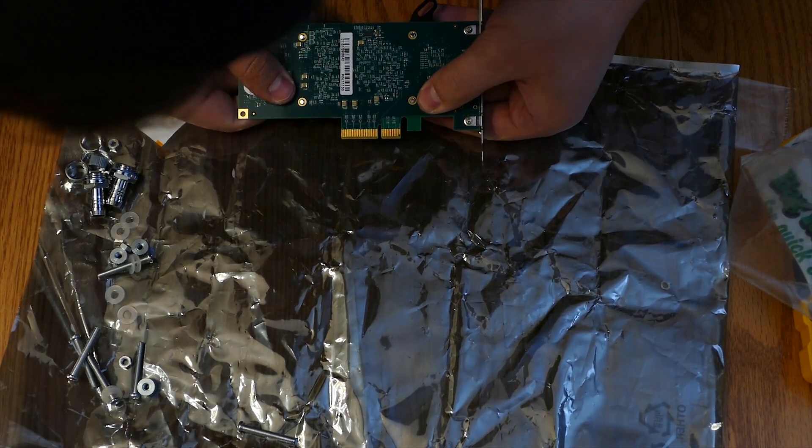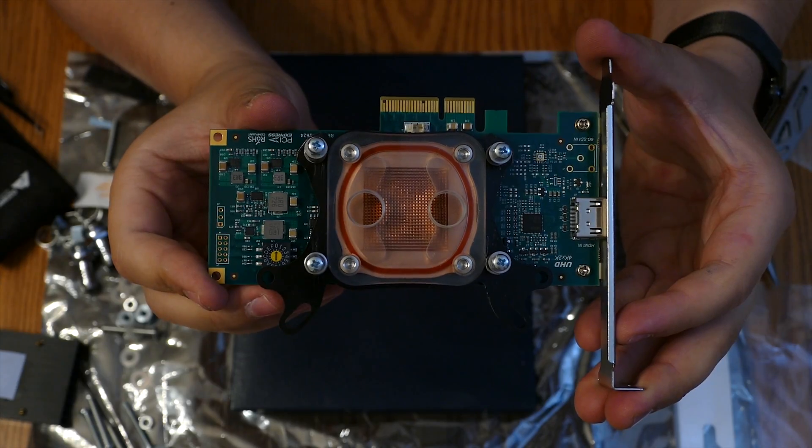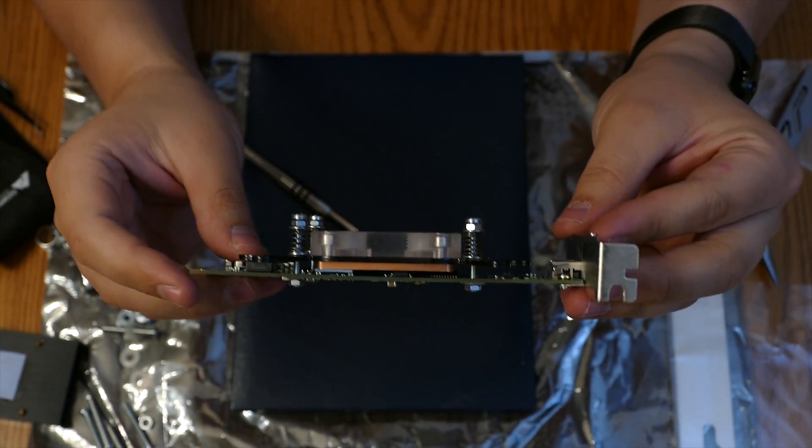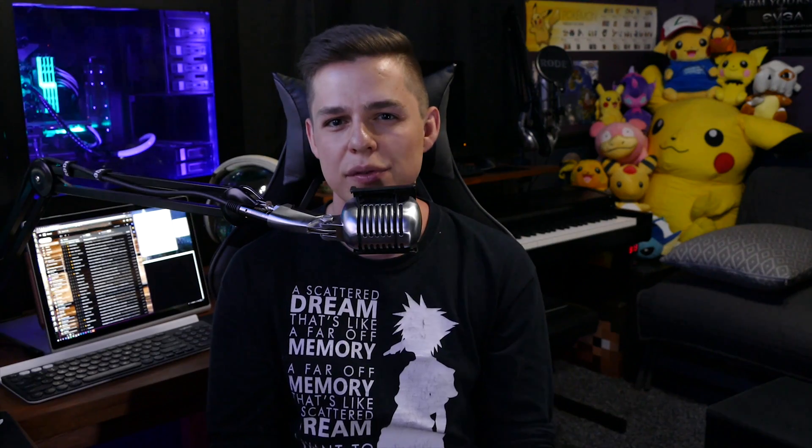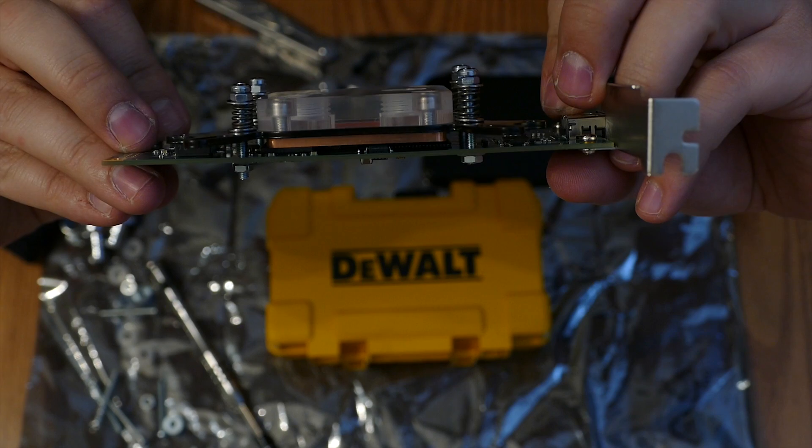I went ahead and got everything mounted. Flipping the card over without the screws falling out is actually much more difficult than it sounds, but eventually I got it to work. When looking very closely under good lighting, I could see that the water block wasn't making perfect contact across the main processing chip. This was kind of strange, as the old cooler was also just a flat piece of metal like the water block, and the graphite thermal pad was basically the same thickness as the old pad they were using on the same chip. Additionally, I reused the thermal pad on the memory chips, so theoretically everything should have worked out perfectly. Tightening the cooler further didn't really help either, as it mostly just pulled the ends of the card up, bending the center and making things worse. The part of the chip not being perfectly covered was the side closest to the memory chips, so I thought maybe if I used a slightly thinner pad on the memory chips, the water block would tilt down enough to make better contact with the main chip.